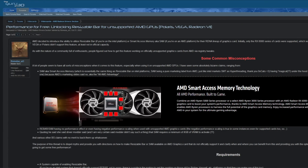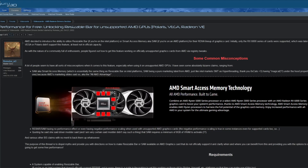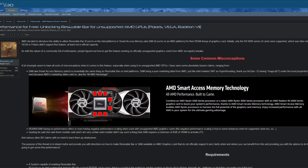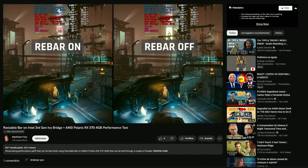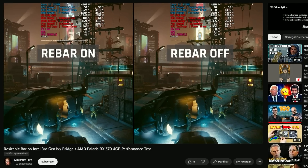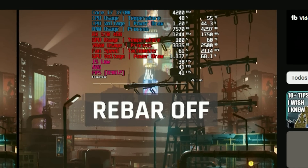If you want to go even further, the link in the description leads to the official thread where I found this fix. For older motherboards that don't support Resizable BAR natively, you can flash a modded BIOS — there's a step-by-step tutorial there. This allows you to enable Resizable BAR on older Intel platforms like the 7-series and below, including the i7 2600K and i5 2500K. I also believe it will work for older AMD CPUs — possibly even the AMD FX series — since if Sandy and Ivy Bridge Intel CPUs work, there's no reason AMD FX shouldn't as well.